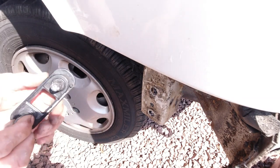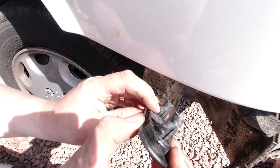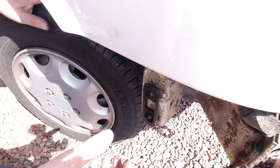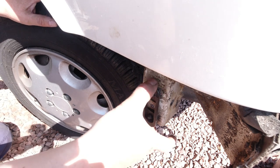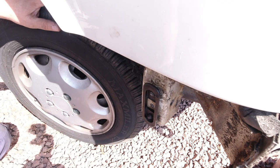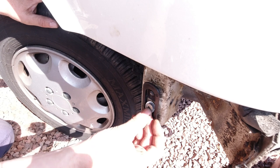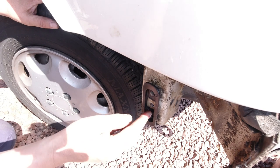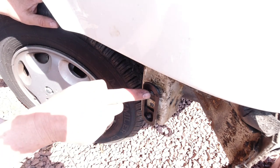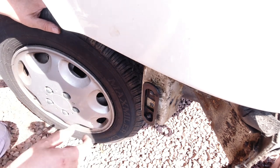In terms of refitting this bracket - the troublesome one on mine - a couple of the flanges got broken but with the pegs still in place it can still be snapped in. It's only using these two edges to hold the bumper in position vertically, so very unlikely to have any problems. It's intended to break away in case of an accident so it doesn't destroy the bodywork, but it's a little slacker than you'd like. What you can do is put a bolt through there with a little spacer washer just to touch those two parts - just make sure it doesn't project above this surface, because that's when you're back into the same problem we had getting it off, caused by the dowels being pushed through too far, which causes the whole problem with getting the bumper off and then breaking the clips.